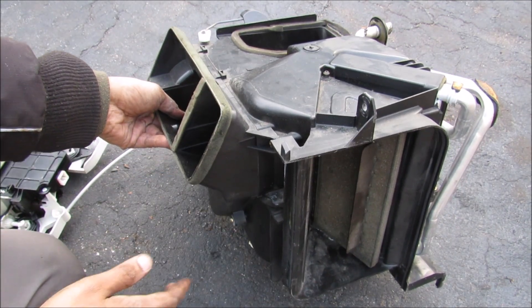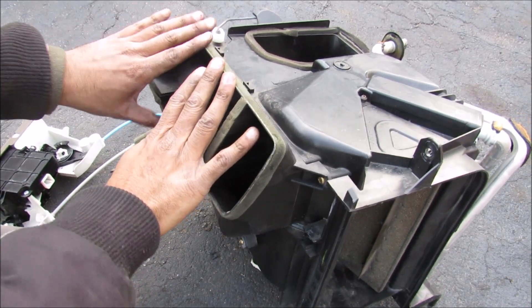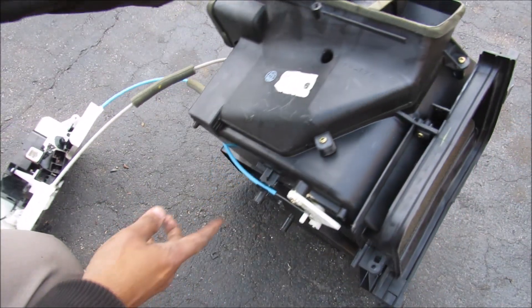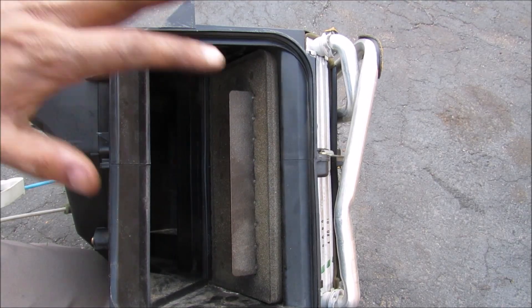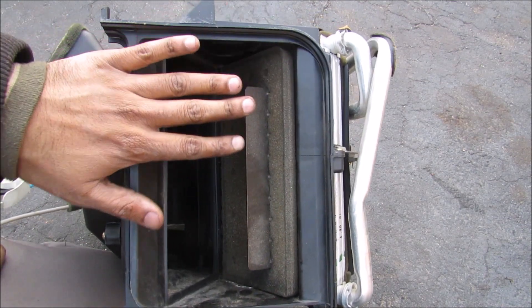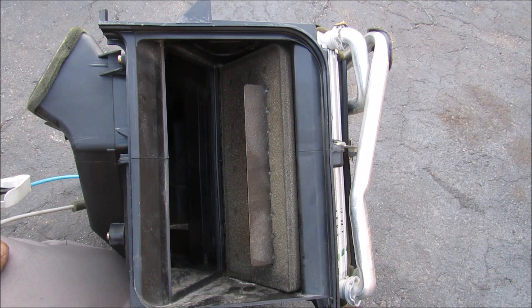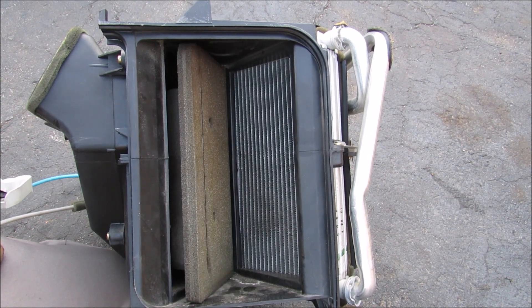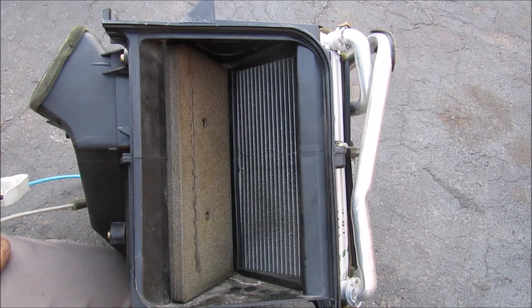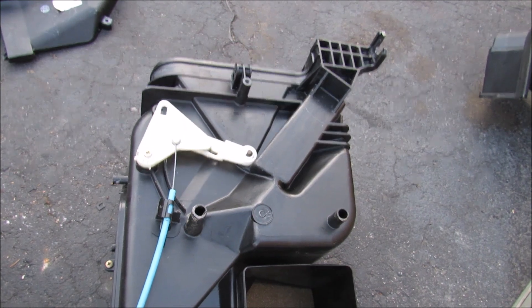Looking at the overall general airflow — here's where the air comes in and here's where the air comes out for the face. Here's where it comes out for the defroster and it comes out the bottom here for your feet. Over here is the flap that controls the airflow temperature that comes off of the air conditioning evaporator. Right now it's in cold and you can see that the air will go directly into the mixer box. If I move it over to the warm position you can see that the air will now be redirected over the heater core to be warmed up before it goes out to the mixer. And this is how the temperature control flap works.